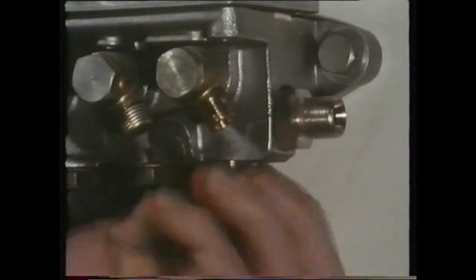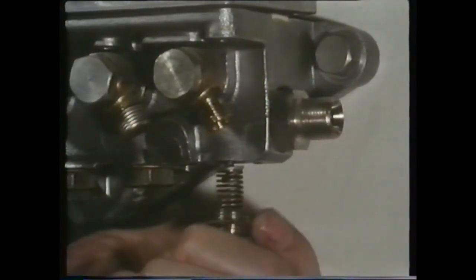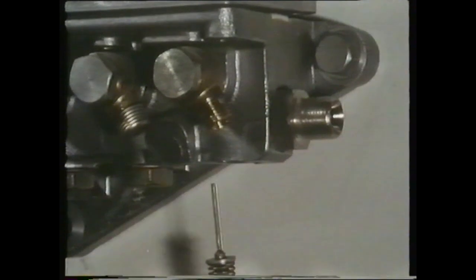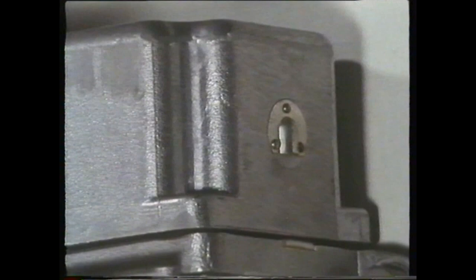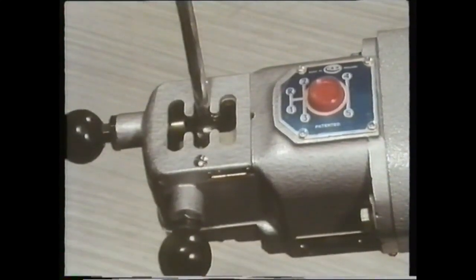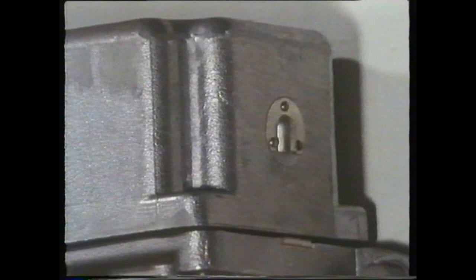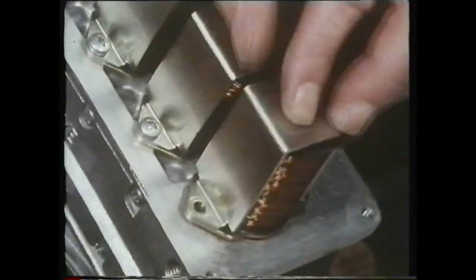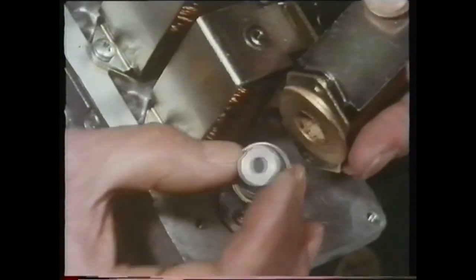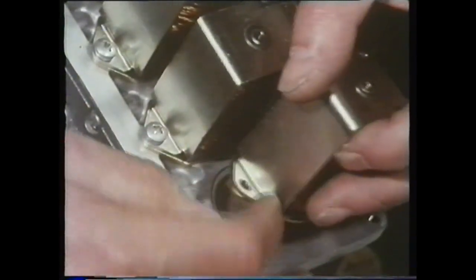The air inlet valve is to be found here, at the base of the EP unit. Within the valve, there's this thin spindle and spring arrangement. A mechanical malfunction of either of these delicate mechanisms will make the valve inoperative or a leakage occur through the vent hole on the side of the cover of the EP unit. Always check this vent hole — first with the gear control lever in neutral to see if there's a leakage, and then engage each gear in turn. If the air leak on the vent stops when a particular gear is applied, then it's the inlet valve for that gear that's at fault within the EP unit. Take note that updated designs of the six-way EP unit have a combined inlet and exhaust valve mechanism that's contained within the solenoid and can't be operated manually. However, the valve requires little in the way of inspection, and if it does malfunction, it's very easy to replace.